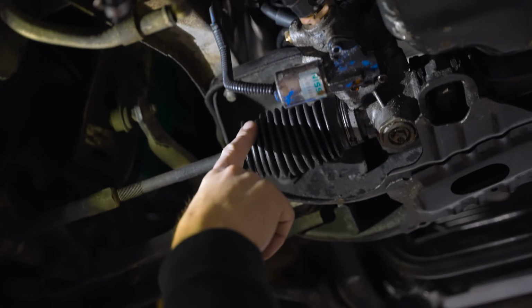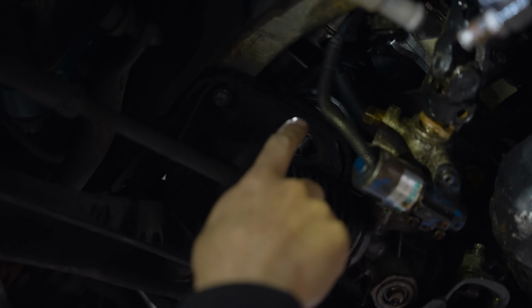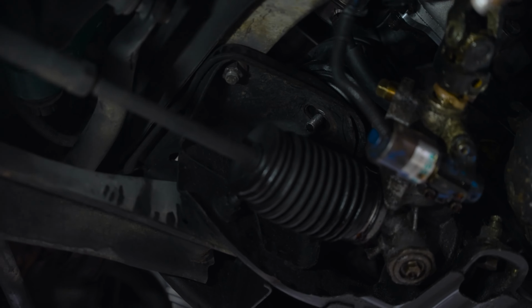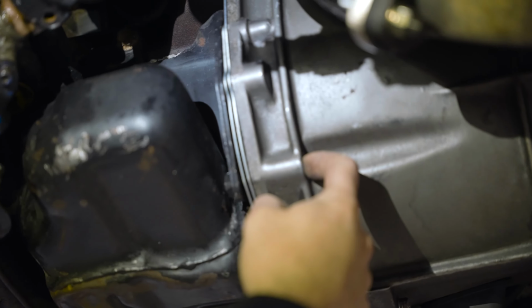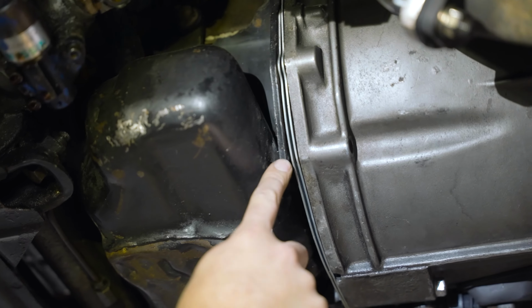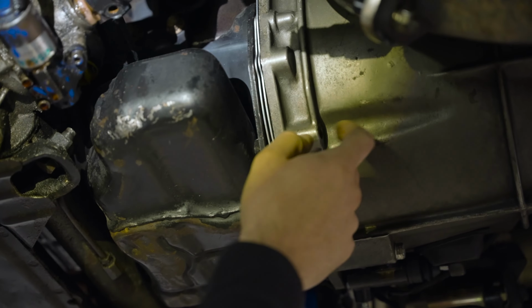Seeing a motor mount nut, and the motor mount isn't in place correctly. So there's tabs. Nissan uses tabs to locate the motor mount onto the subframe. That'll need to be fixed. Put a nut on it. We're missing some transmission bolt hardware here. So there's a bolt that goes here, and a bolt that goes on this side. And then this bracket's going to have to get loosened up so it can line up to the bolt hole.